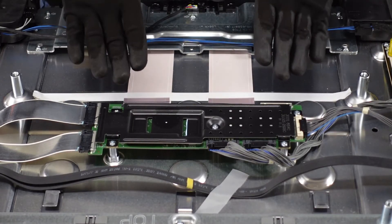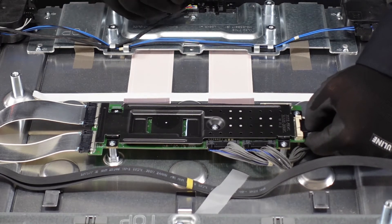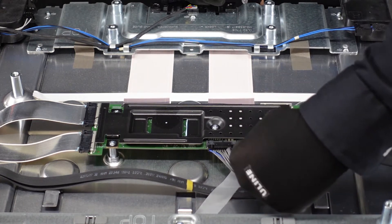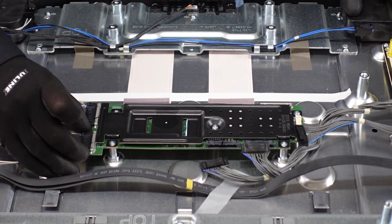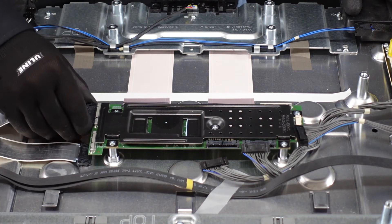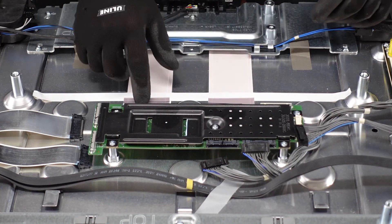Now we're moving on to the T-Con board. We're going to want to get these clips away from the board first. These are going to be the style where we use our thumb or thumbnail to push down on the clip, which releases it — that comes right out. Same exact thing with these two on the top. And then these are going to be the style where we pinch on the right and left side, which depresses the small buttons and releases that ribbon cable, allowing it to come right out. These two on the back, just use your thumbnail or fingernail to pop up the two flaps for the ribbon cables.